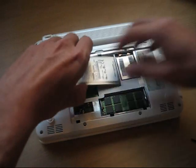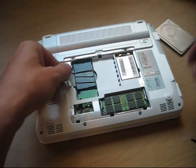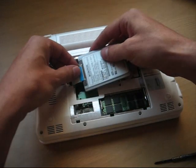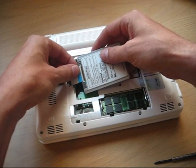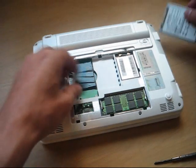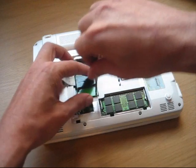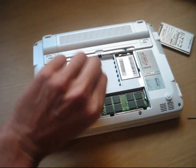It's a really easy job. You just unscrew the SSD, put the adapter in, and put the cable to the hard drive. This adapter comes with the cable. And that's it — you can use a hard drive on the 901.